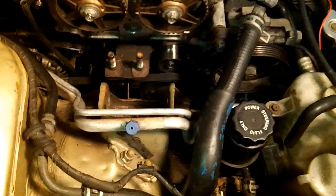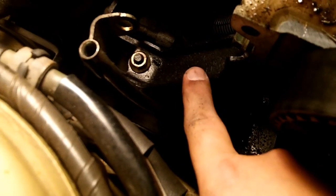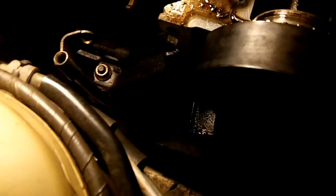Alright. Once you crack them loose, they're really easy to come out. And these are fairly small bolts that are holding that pulley on. Alright, that's 2 down, and then just keep going around until you get the other 2 off. This bracket does not come on the automatic transmission. There's a bolt here and a bolt there, and you have to take those 2 off to get that bracket out of the way first.